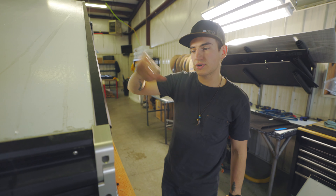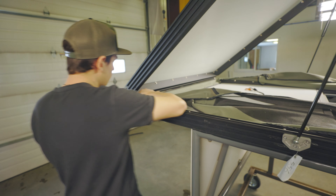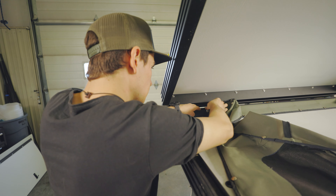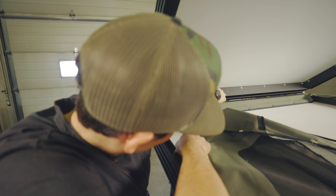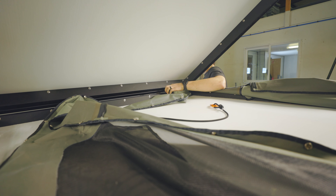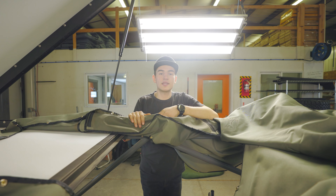Now to get these last few snaps across the front of the tent, you'll most likely have to release the roof of the tent so that it's no longer compressed. That way you have a little bit more working space to jam your fingers into this front groove in the extrusion. Now we've got our whole tent unsnapped — just pull it out of the way and then get our replacement tent to put back in.